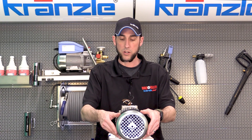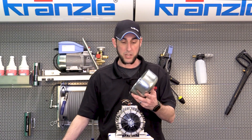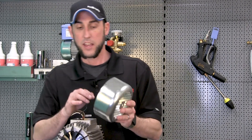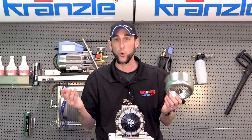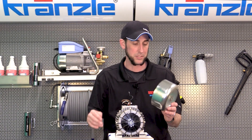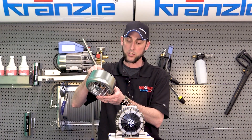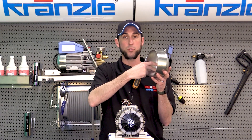Once you can remove all the hardware and slide off the cover, any dents that might be in the housing will become pretty evident by looking on the inside. If this was making a loud racket, this plastic fan has probably left some black plastic marks where that dent is. If you find a dent in the cover, the easiest way to fix it — if you have a ball peen hammer, by all means use it. Some metalworking tools make it easy to knock out. For those of us that don't have metalworking tools, using the butt end of an old screwdriver can be helpful. When you're hammering into it to punch it out, lay it onto a folded-up cloth so you can hammer out that dent and get it back to as round a shape as possible.